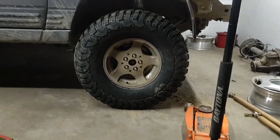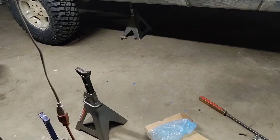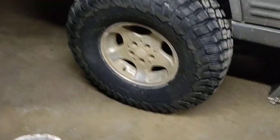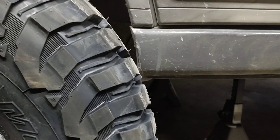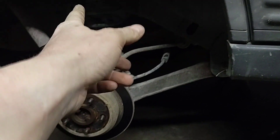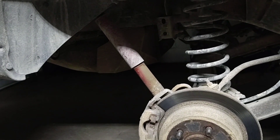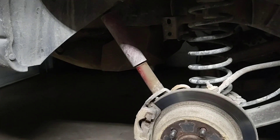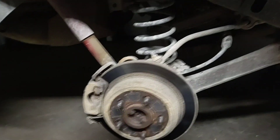That's it — that's a 33 with a three-inch lift on the front. There's still some weight on the jack stands in the back, but that's about where it's going to sit. I thought I'd have more room and just have to trim the bumper, but I didn't realize just how far forward the axle is. This thing's going to sit so close — it's going to be damn near touching. I'm going to put V8 front coils in the back; for today I'll do the puck. I hope the shock is long enough to have a little travel so I can drive it — not in the woods, not flexing.